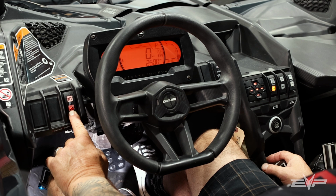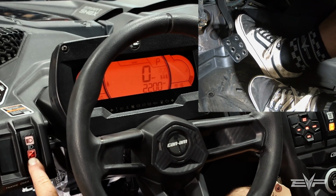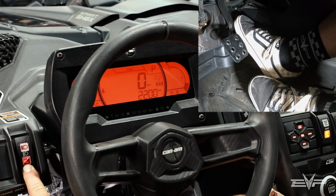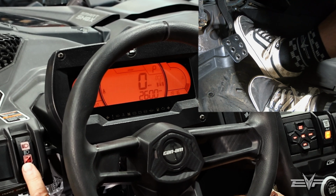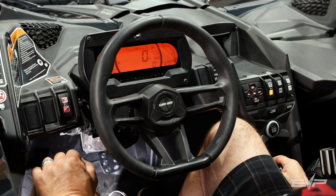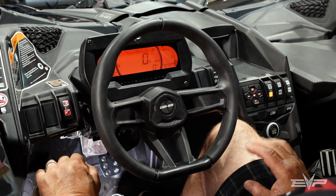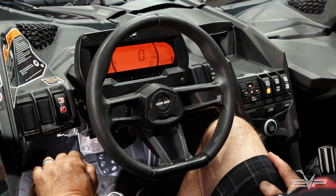Okay, so let's just say for this vehicle we want to set it at 2500. So we're going to press the gas pedal to where it gets to 25. Let go. I missed it. I got 26. But anyway, for the sake of this video, let's just say it's 2600. After you let go of the headlight button, now it's set. You don't have to set it again unless you want to change it.